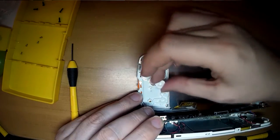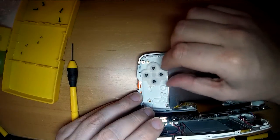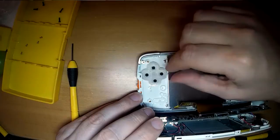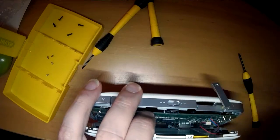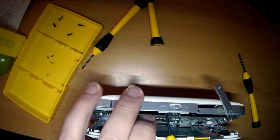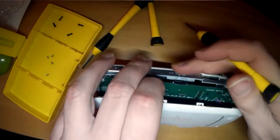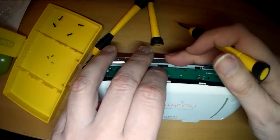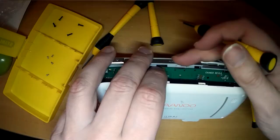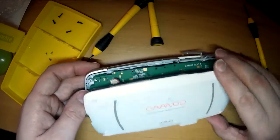Just be aware that the buttons do shift and move around, so it makes sense to realign everything and put your little rubber pad back on top. Putting it back together there is another trap: the volume control casing might not be aligned with the potentiometer on the board. Make sure that it's actually hooked into the board — if it's not, you'll end up with your volume jammed on maximum or jammed on minimum.